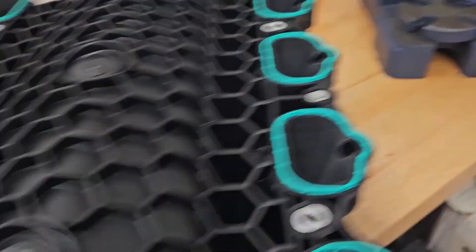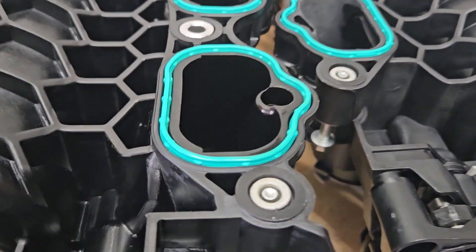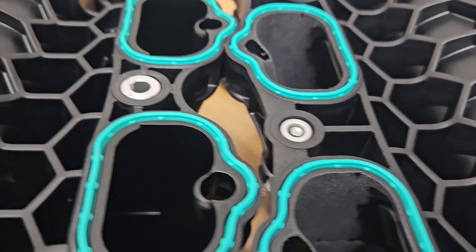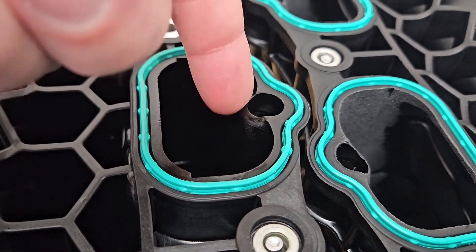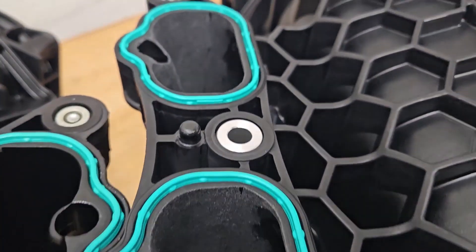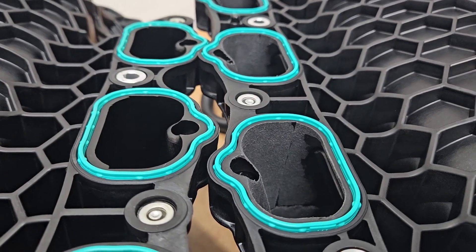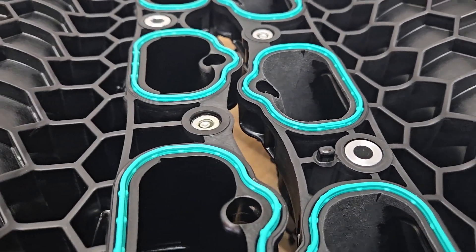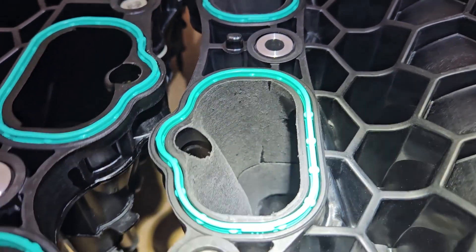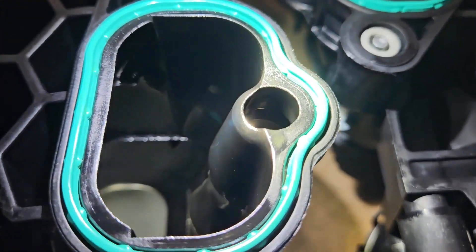I'm not going to go over the sides — just what's close together — so you can see the differences. I only worked on the long side; I didn't really touch the side where the IMRCs are. Notice the big difference in the injector bosses — I took as much as I could off those until it started getting into where the O-ring would sit. I didn't go crazy here. When you get a port from a Barber or 1320, those guys do much more significant port work.